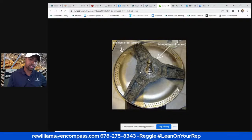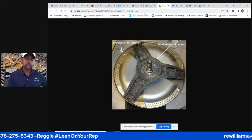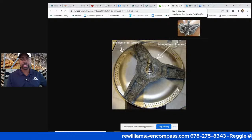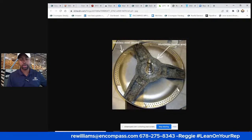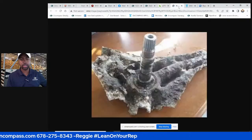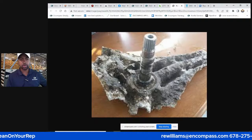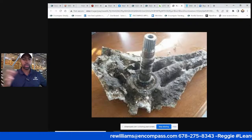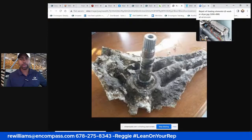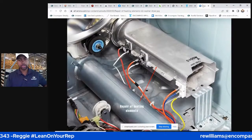One of my philosophies is powder detergent. Sometimes you see powder detergent caked up on these things when you take them out and disconnect them. There's a number of different reasons. A good prevention method is white vinegar. White vinegar will help keep that thing going strong and clean. And here's an illustration of one that's corroded and broke. And usually you'll get a wobble, right, when that happens. So, very common on any front loader. But I haven't said a lot on the old LG ones.